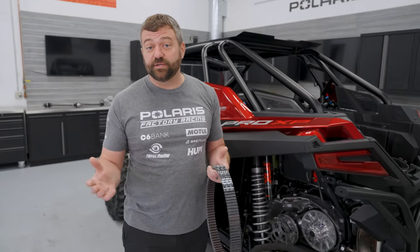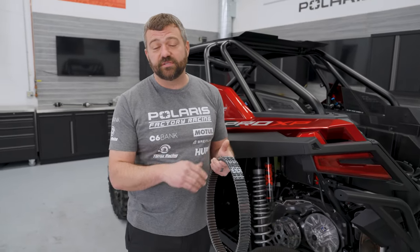If you're running in the dunes and need to replace a belt, low gear is your best friend — stick to the smaller dunes. It'll take about five to ten miles, and be sure to run all-wheel drive in those heavy-load conditions like dunes, because if not, you can actually damage your belt right away.